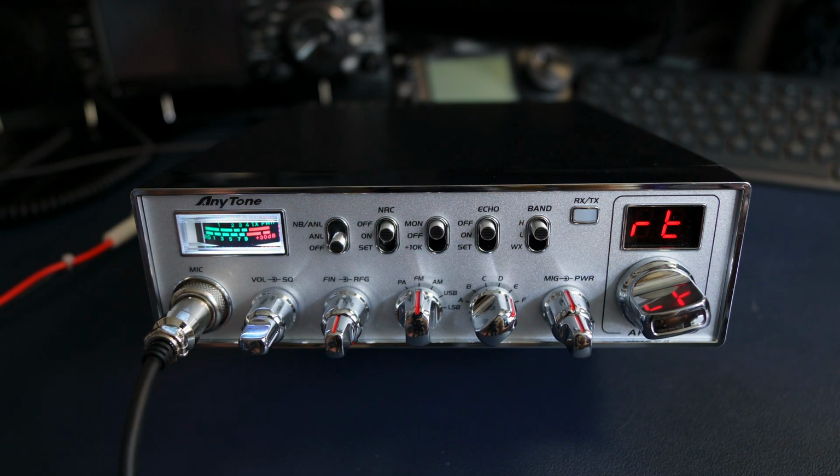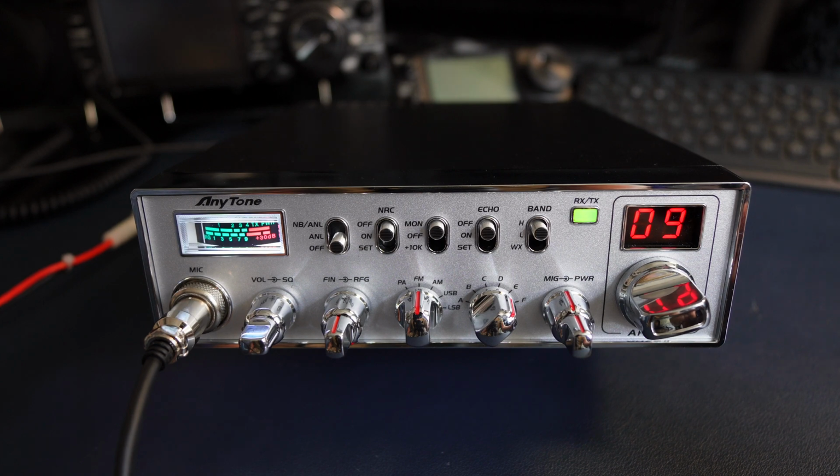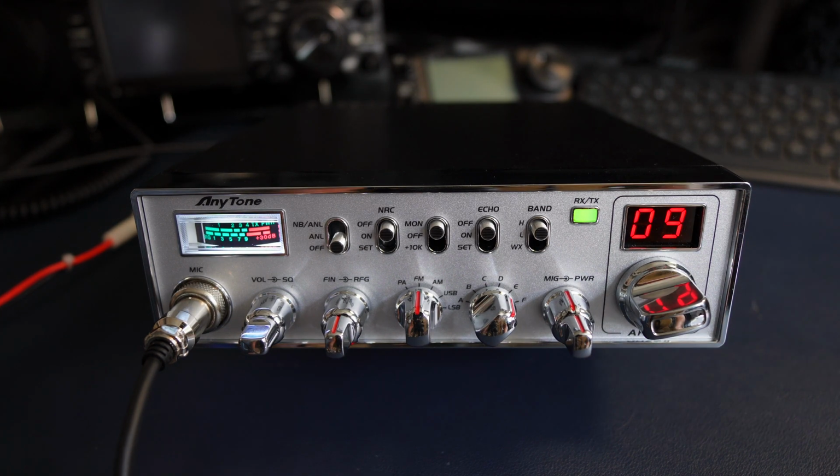So basically, if you switch off, press PTT, and you'll see what happens. I shouldn't be doing this, it's going to take me time to get it back how I want it again, but anyway, I'll show you guys. So you hold that in, she powers off, and she'll power back on. Now it's reset, look, beeps back on, and all my menus need sorting back out again, but I've got them in my head. So like I said, I thought I'd just show you there.